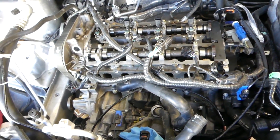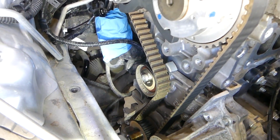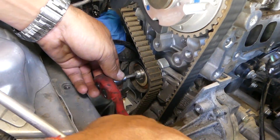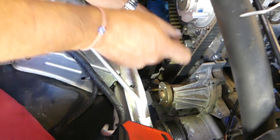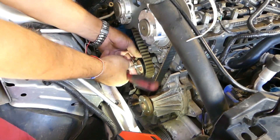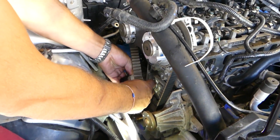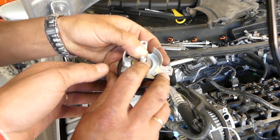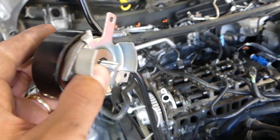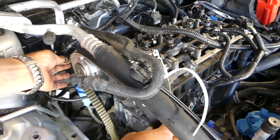After that, we remove the bolt using a Torx 40. The bolt came out perfectly — this is the tensioner pulling out. You can see it has a retainer on the back with a rubber bushing that holds the ball in place. Then you can go ahead and pull the belt out on each side.